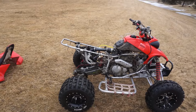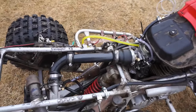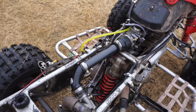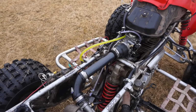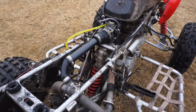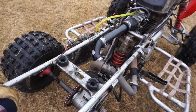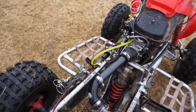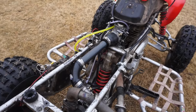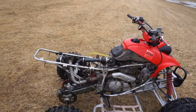I don't know if I'm doing something wrong or what, but I've tried pretty much everything. And that fuel regulator didn't really work out too well either. I had that thing on there and rode down the road, and it didn't make a difference. So it's not that. And then the piping's all correct, no leaking out of the piping, and still doesn't make a difference. Carburetor's all set up, reference to boost, pressurized, doesn't make a difference. Still runs like crap.